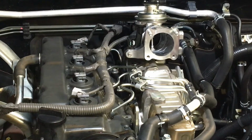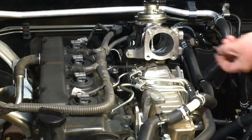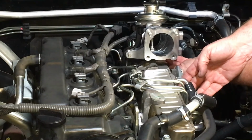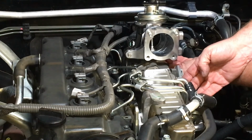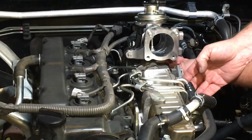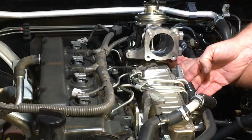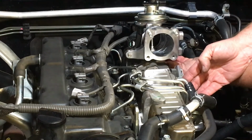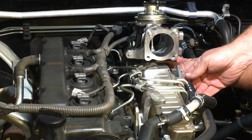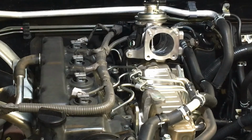A little bit of lubey lube, and the main reason we put lube on there, anti-seize, not because they ever seize, but when you wash your engine down, depends what degreaser you use. Like I love that Kenko stuff, but you've really got to make sure you rinse it off thoroughly. Don't leave it sitting around because it is caustic sort of, it'll cause corrosion and eat into stuff. So the key thing there is make sure you wash it off thoroughly. Don't be a water saver and go, oh no, you don't want to waste another 3 litres of water. You're going to have to just make sure it's right by finishing the job properly.